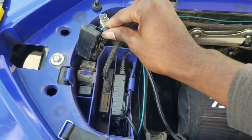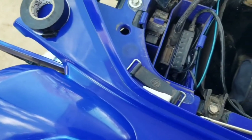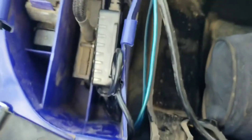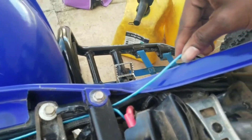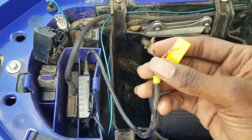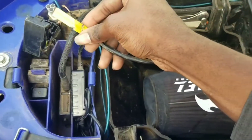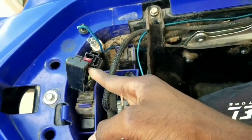Make sure you tape it up real good. Then you're gonna do the same thing — run that wire on the side of the air box. You can see I got it coming through on the side of the air box right there. I got a lot of excess wire so I'm just gonna clip this off a little bit, and then I'm gonna connect it to one of these fuses right here. When you get your first power wire ran, you want to do the same thing for the first ground wire. All I did was ran another piece of wire through on the side of the air box, looped it through, and when I get ready to connect it, all I have to do is connect it to the ground terminal right there.